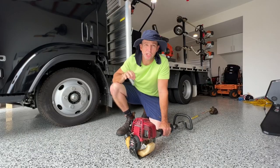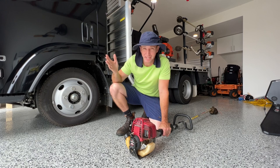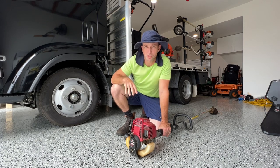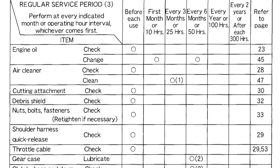How often are we changing the oil? For most people, they just do it when they get a chance — me, on a rainy day. If you want something a little more solid, Honda's recommendation for this particular trimmer is to check before starting every time, then to change the oil every six months or 50 hours of use. If it's brown, do not frown. If it's black, give it the sack.